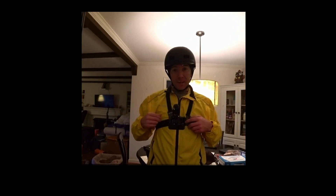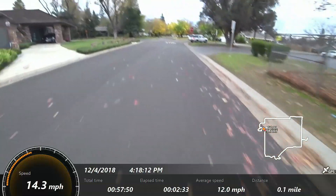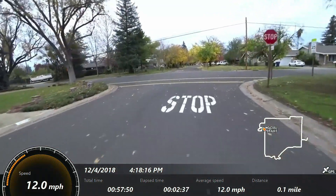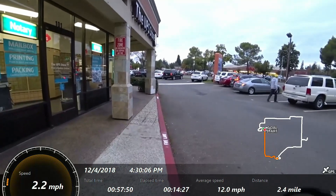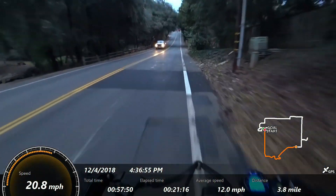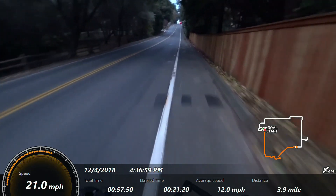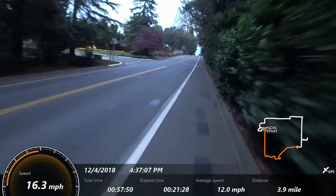Here's the first range test — I delivered a package with the EcoRico S5 to see how far it goes. I got about 11.5 to 11.6 miles. My average speed was 12 miles per hour and I topped out at over 22, with a downhill section. It was 52 to 50 degrees with 6 to 8 miles per hour wind from the north-northwest to north-northeast. Motor temperature was 105 degrees at the end of the test, which is a little high — I think it may have to do with the smaller diameter wheel.